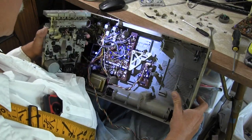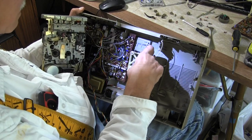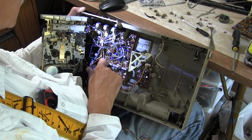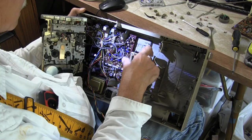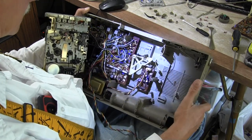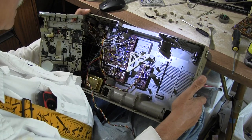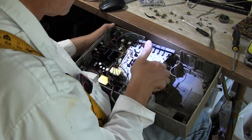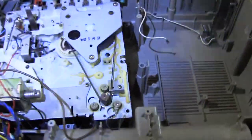This thing up under here is your recording bar switch. If it never moves over a long period of time it will get gunked up — it's already dusty, and dust can come in on the back side and fall down in there. This really needs to be cleaned, and your switches are difficult to clean but it can be done. This is fairly clean on the inside but it does need some touch-up. I'll bring the camera down and let you see it up close.